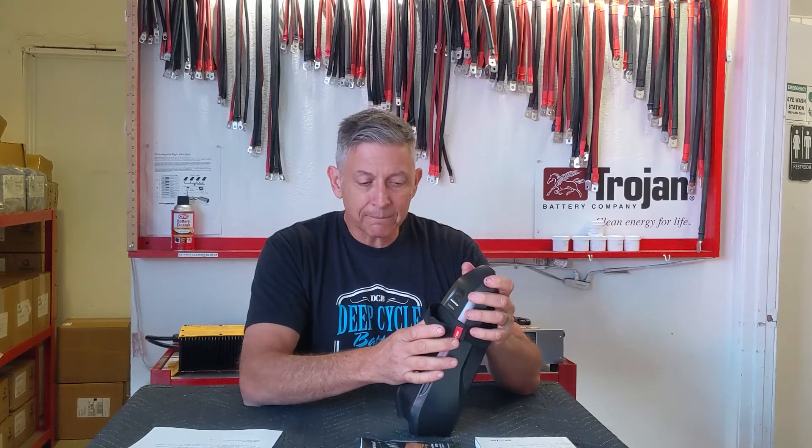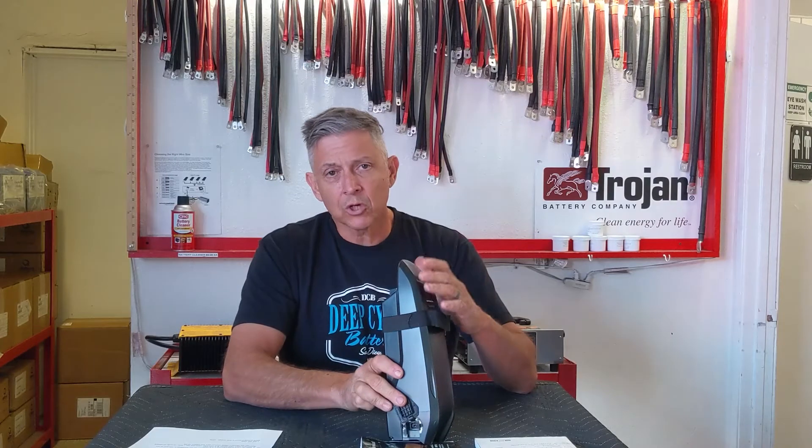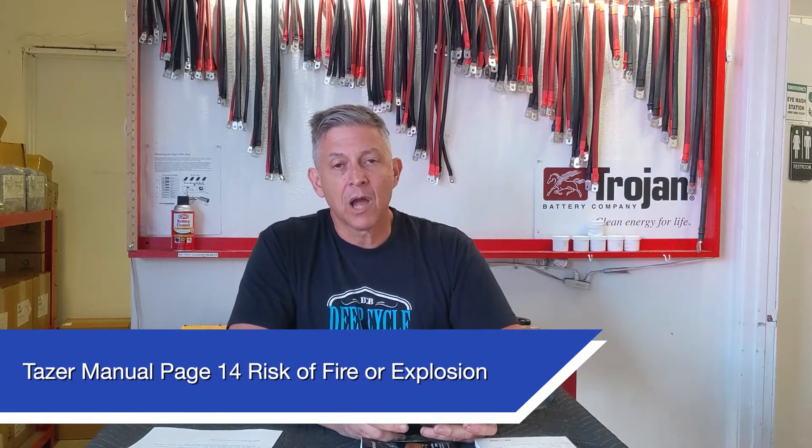This battery is located in your down tube and it comes with a battery strap. I highly recommend using the strap, and I'm a big believer in leaving the battery inside the down tube when charging. You simply connect the charging cable to the charging port, which has a dust cover. The reason I recommend leaving it in the down tube is the risk of dropping the battery. You do not want to drop this and let it hit the ground. Any kind of impact could compromise the lithium-ion cell integrity. The lithium-ion can have thermal runaway — meaning fire — if the cell integrity has been compromised.